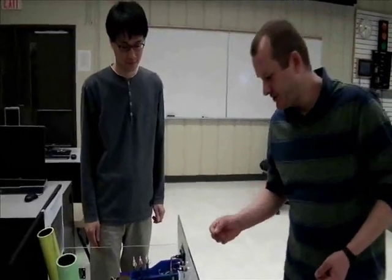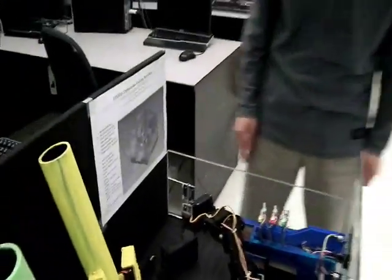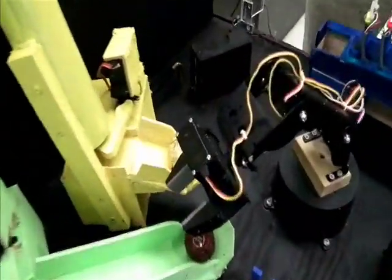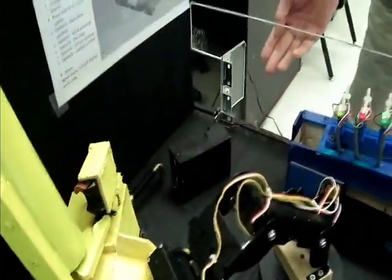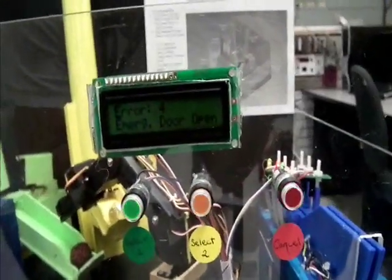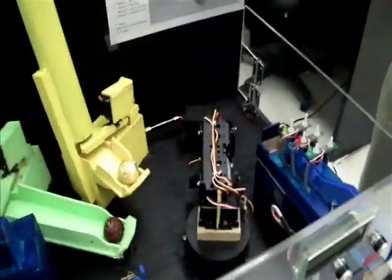We are going to show you some safety features. I insert two dollars, select the chocolate, and now the safety door will be opened while it is operating. The door is open, the alarm is sounding, and the operation is frozen. So if I put the door back, it is still sounding. I need to press the reset button. When I press reset, it goes back to normal operation.